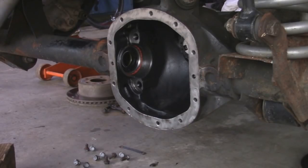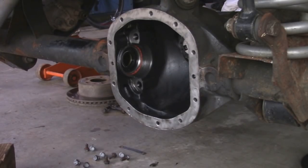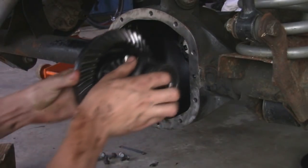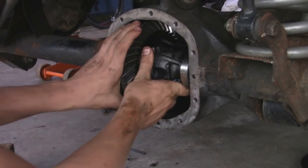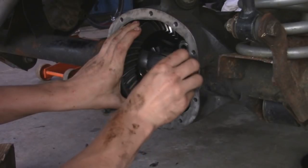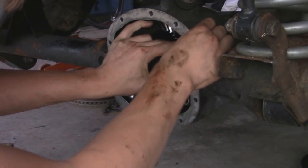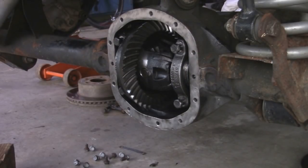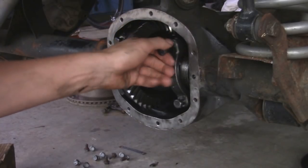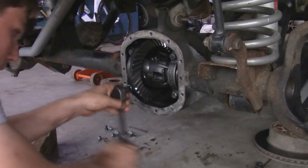So now we're ready to go ahead and put the carrier back in. After I degreased it, I went back and took some gear lube and made sure all the bearings are lubed up. I did that also with the new seals so that nothing goes in dry and gets worn out right away. Make sure it's exactly the way you took it out — everything on the same side. Now we can go ahead and take our bearing cap, fit it into place, and make sure the Ys match up in the same direction. I'm going to start these bolts just to hold it in place, and then take out one bolt at a time and put some red Loctite on there. Tighten everything up evenly, going around just like a tire.